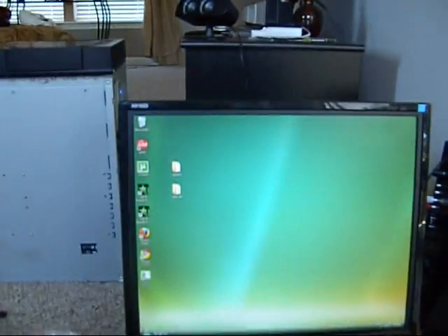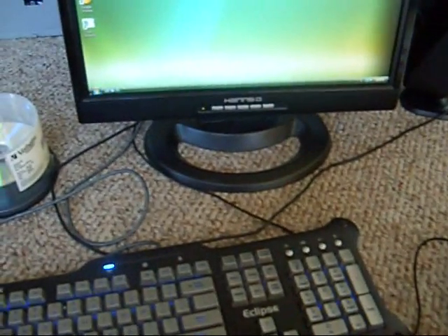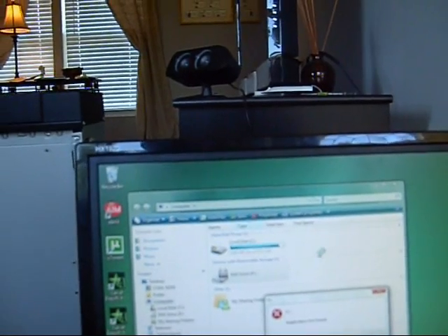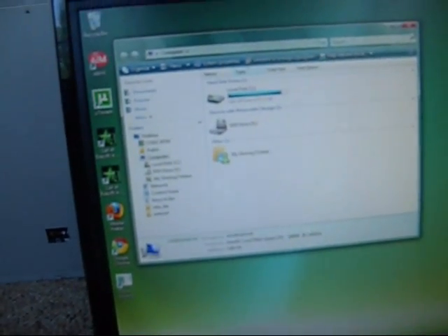Looks like Vista's still booting up. I'm going to grab a spare USB drive and copy the SATA RAID and SATA IDE drivers, then I'm going to burn some discs to get my data off of this one. Then I'm going to install Vista 64-bit right here — that's my CD. Let's just see if it recognizes my 1TB drive, just for fun. It doesn't. Interesting. We'll have to figure out why in a minute — probably because I don't have the RAID drivers set up.